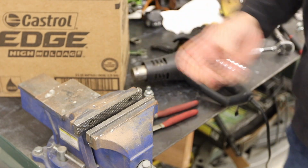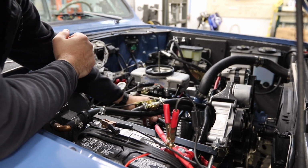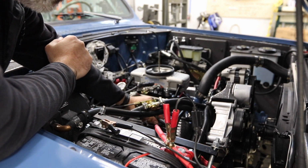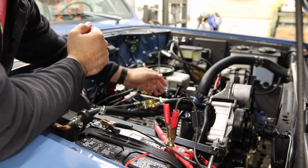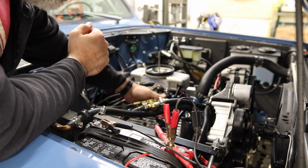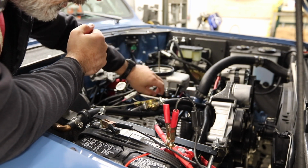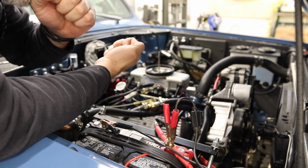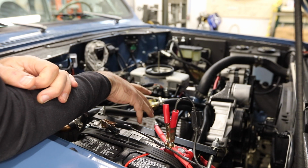No way I can film it, but you can see it. So this is my new PCV. Let's get it on there. So I just put the PCV back in here. I've already checked the catch can to make sure that's not a source of a vacuum leak. I basically took the hose that goes to the PCV valve and the hose that goes to the spacer here, and put my thumb over it and sucked it, and it held a vacuum. So that's not an issue.